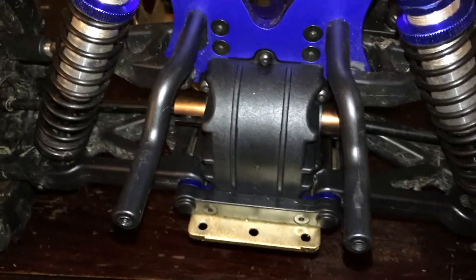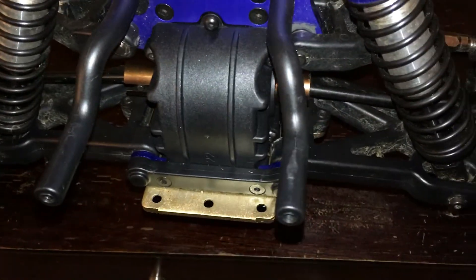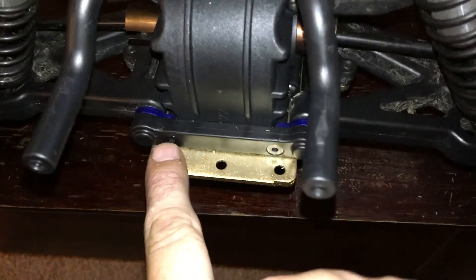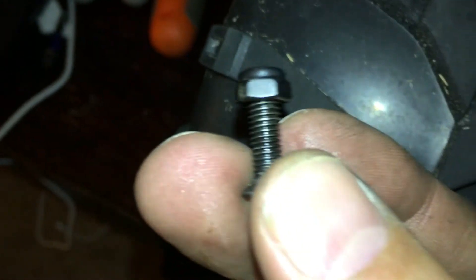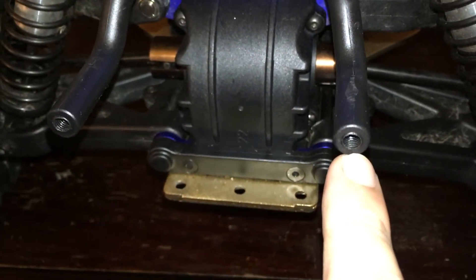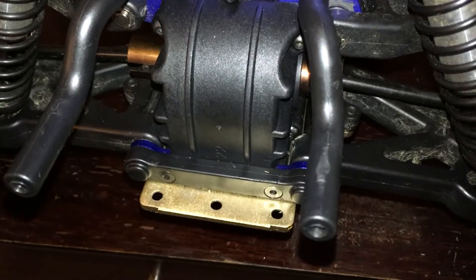The bumper's still off but it's drying and I'm still going to try to JB weld that, so I'll throw that back on when it's done. Got one, two, three bolts and those are actually connected through the chassis with nuts. And then you have just these two front bolts right here on these structural posts and the bumper's back on.